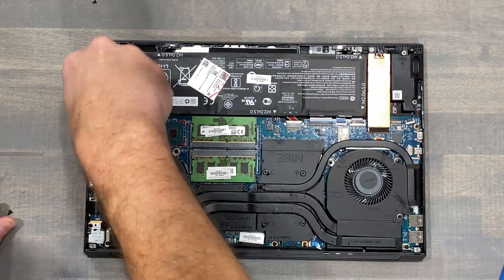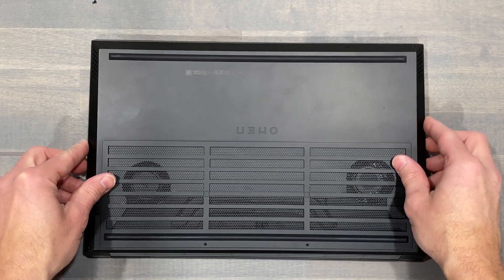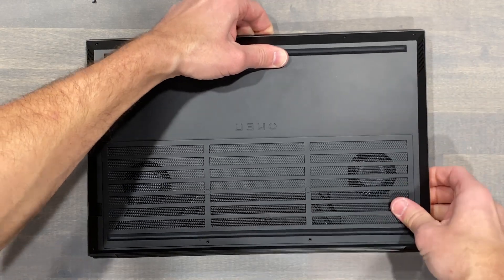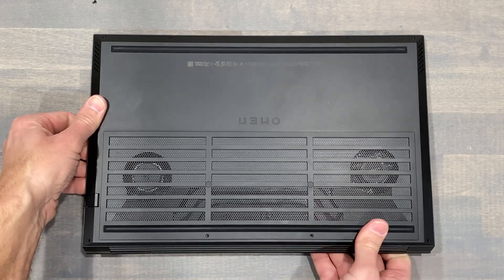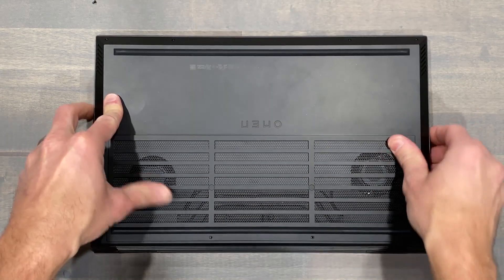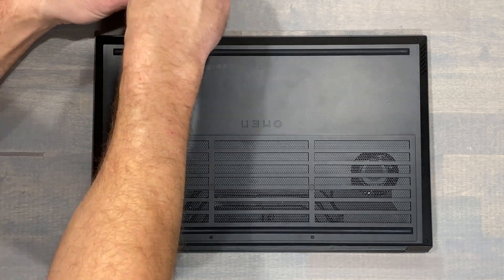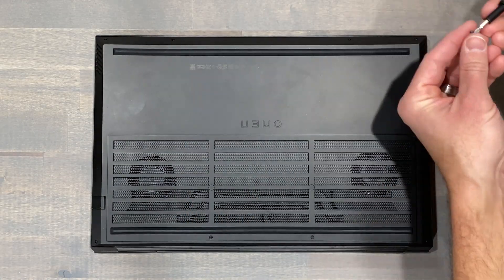Success! Secure the battery back into place, then reinstall the bottom panel by setting it into place and pressing down gently on the edges — it'll pop and click into place. Then reinstall the four long screws in the rear and the four short screws in the front. The two short screws in the middle may want to jump off your screwdriver as they pick up a magnet within the chassis.